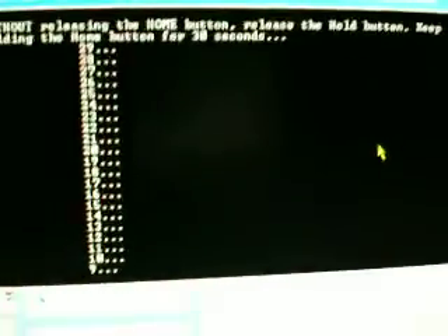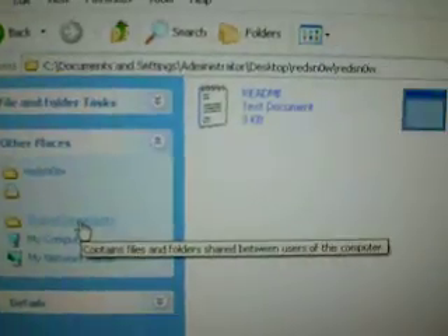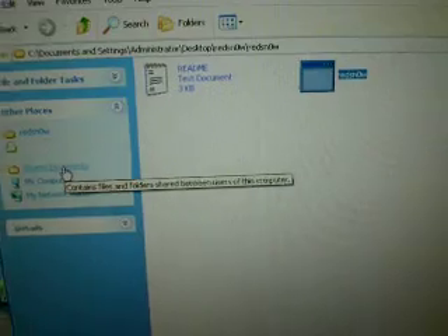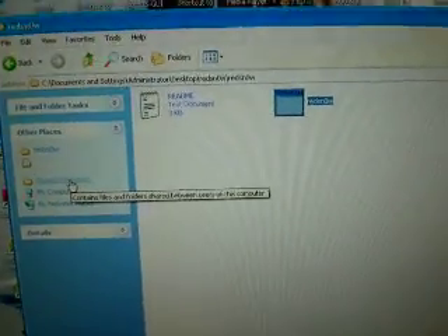You should see at the bottom right of your screen it says something like 'USB device connected — DFU iPod'. It should count down: eight, seven, six, five, four, three, two, one, zero. Since my iPod isn't connected it will just shut down, and it should say 'successfully entered DFU mode'. From there you don't need to do anything else — it will do it for you.